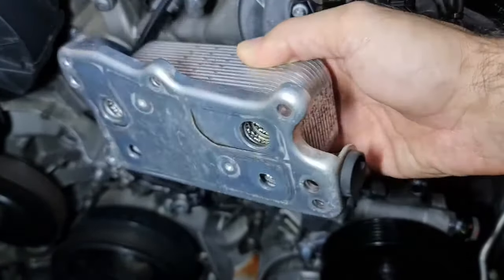Okay, the belt is on and it took 5 minutes to figure out where to go because this is complicated. We have three idler pulleys, and believe it or not, you should do this yourself. But it's not so complicated when you have a diagram. So now we can release this pin from here. Okay, again, number 17.